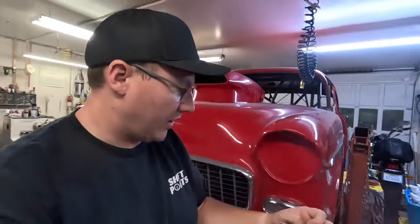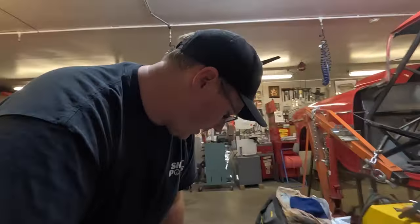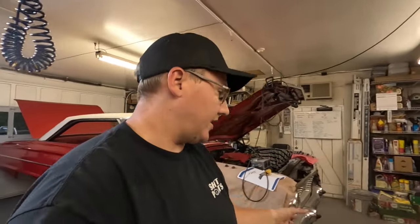I showed you guys when I bought this stuff, but I wanted to quickly remind you. I've got to find it. I have this oil that's made by Lucas specifically for classic cars. It's a high zinc oil to protect the camshaft in this thing. Want to make sure all that stays good. Last thing we need to do is kill it right on initial startup. So I gotta find that oil that's around here somewhere and get that put in it. Then we'll get the antifreeze in it, and that'll have the fluids wrapped up.